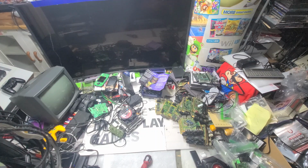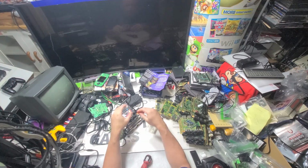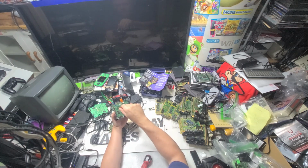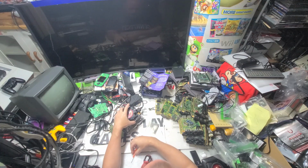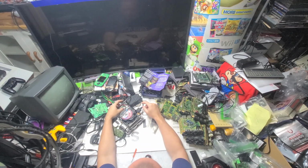I have all little sayings I use: electric slide right, spindle jiggle, and then you want to hear your laser board chirp. That's a good thing. Normally I would go left a hair at a time to see if I can get it to work. I don't measure anything. There are no measurements in these. Anybody who tells you that, that's silly. It's whatever this exact laser board is doing to this exact spindle and lens assembly. I don't think I'll get this one.